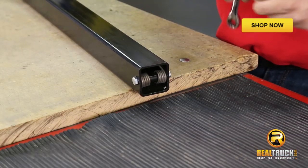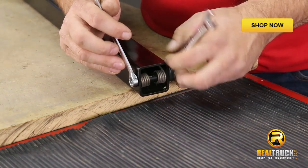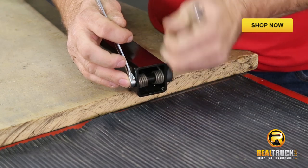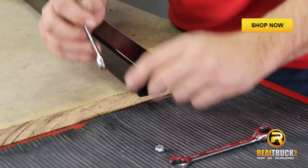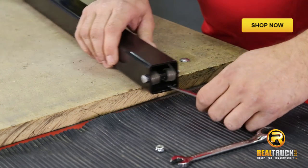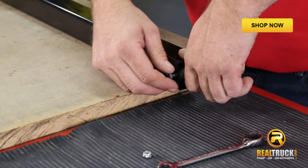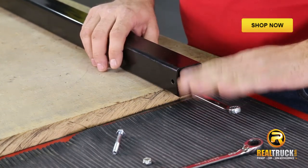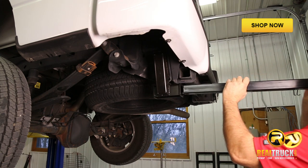What we want to do now is grab our two 7/16 wrenches and take this nut off of this side. Then put our wrench up in here. Once you slide the wrench up in there, just use a little thumb pressure and lift up on it a little bit and you can slide that bolt right out of there and you're ready to go. Do not take this wrench out — leave it in there until we get this bolt back in once this is on the truck. So let's get this up on the truck.